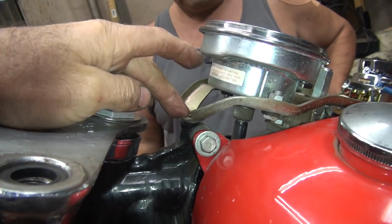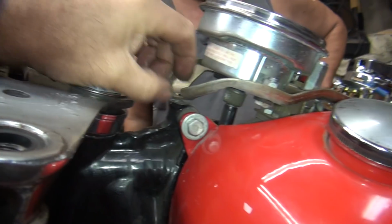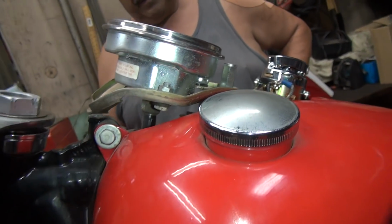Oval. Now remember, this is springing up because when I pulled it down, it does that. Right. So it wants the spacer here, but nobody put it in. They jacked it up back there, but they didn't do anything about the front. So now we need to rectify it. So we're going to have to do a little shimmying.